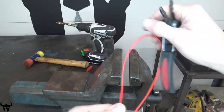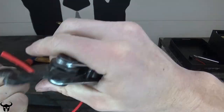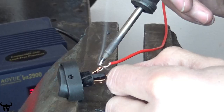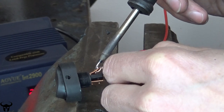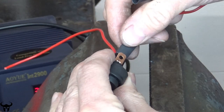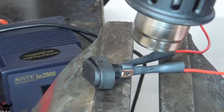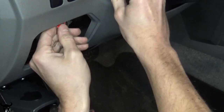Get your 18 gauge minimum stranded wire out. I'm making separate pigtails for this switch. Twist the wires onto the switch and then pull them to make sure they stay. Bust out the soldering iron and solder the connections as well just to be thorough. Shrink wrap every connection possible, then use a heat gun on the shrink wrap. Reinstall the switch with the pigtails back in the car.